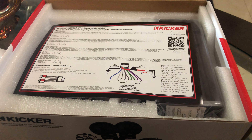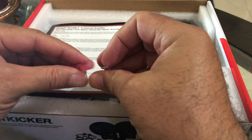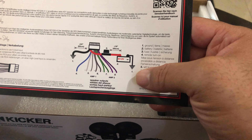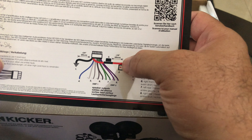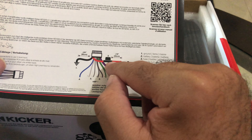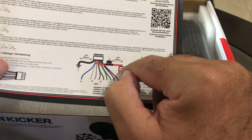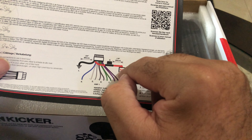To connect it, I'm going to be using spade connectors. I chose spade connectors because if I ever have to do any servicing, it's just a matter of unplugging all the cables. For the rest of the installation, it should go pretty easy — it's just getting the power cable running to the battery. I do have the Crutchfield install kit. I'll put a 20-amp fuse in the Crutchfield install kit within 12 inches of the battery, use the 20-amp fuse that came with the Kicker, and this will act more like a fuse just for the amp, while the 20-amp close to the battery will act as a fuse to protect the wiring. I see nothing wrong with double protection with dual fuses in line.